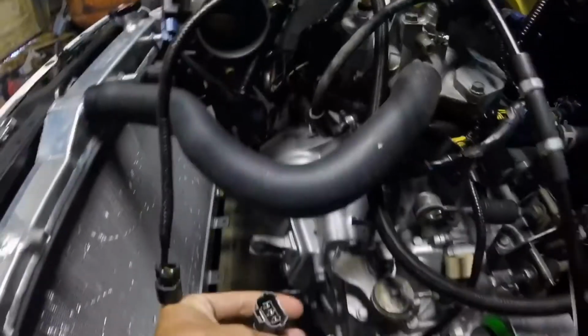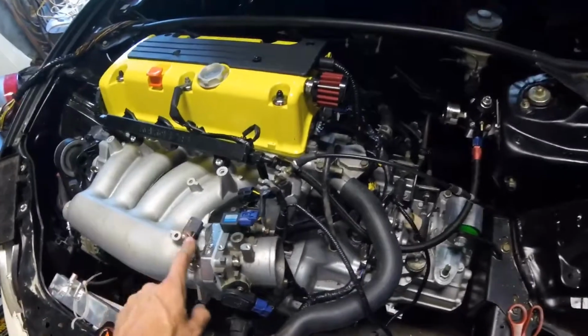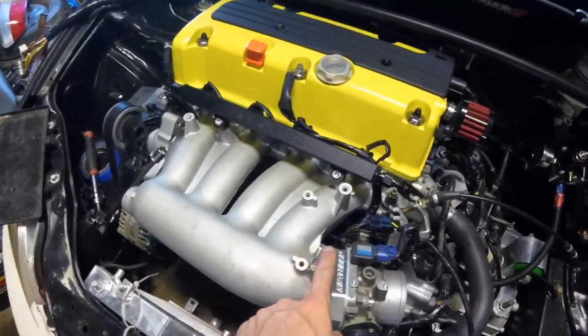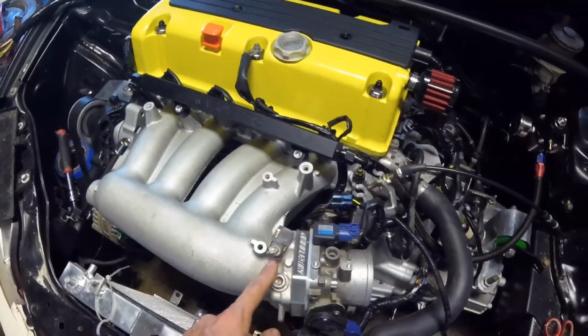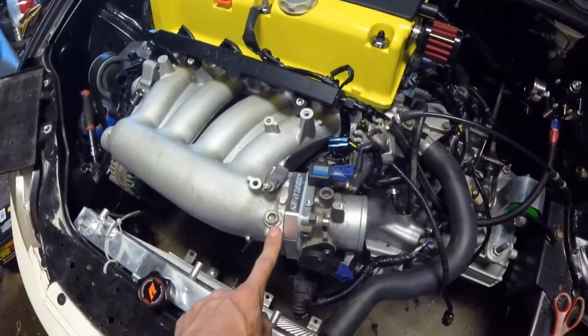I have to switch out this plug-in due to the 06 plus transmission. And gotta pull the battery out to run all of this inside. I still need to buy a block off for this. This is an old grinded down map sensor just in there for the time being. I did get the hole tapped and put this plug in there.